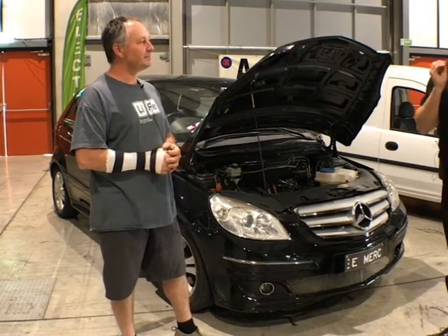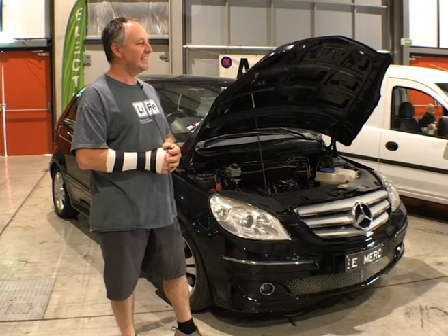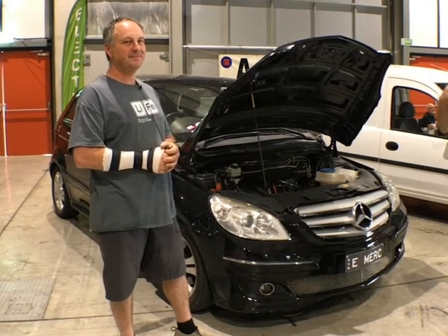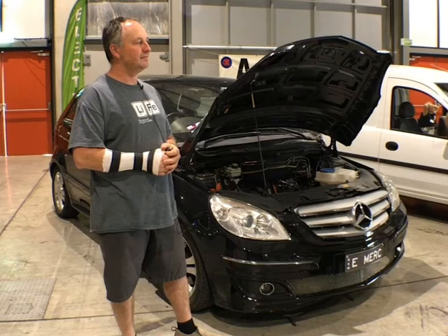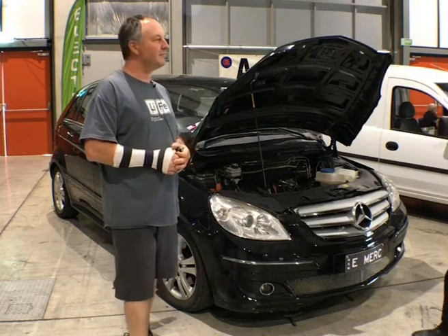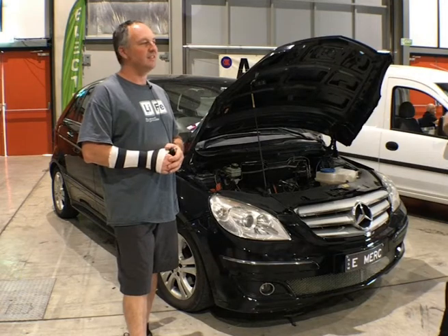When I was first driving it, the motor controller was a bit idiosyncratic. If you started it too suddenly, you would actually get the car kangaroo hopping — normally you associate that with petrol cars on a manual transmission, but this electric car with an electric motor controller would actually kangaroo hop. My theory is that when you first engage the motor, the resistance is so low that the inrush current is so big that the motor controller says 'too much current' and cuts out, causing the kangaroo hop. We adjusted the parameters in the motor controller so that when you first start up it doesn't apply so much current, making it less likely to kangaroo hop.